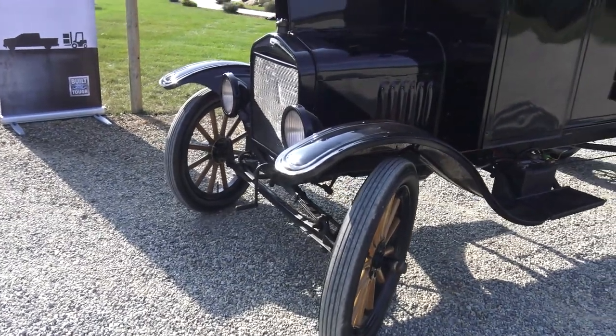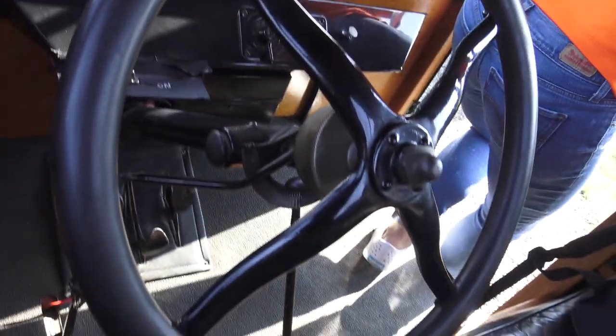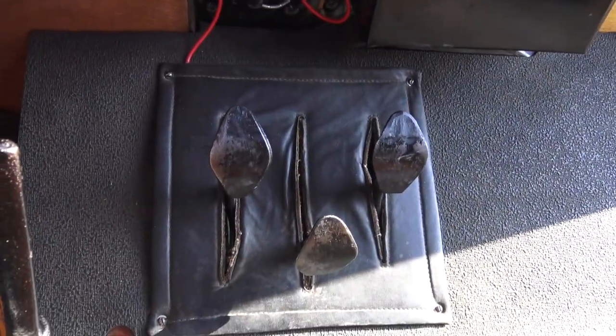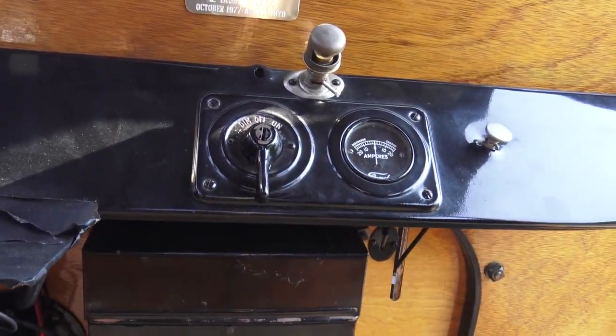The leaf springs — the Corvette had that back in the 70s. The old joke about a Model T: what do you call shock absorbers? Passengers. There are no shock absorbers. When the Model TT truck was introduced, we've got an on-off switch there temporarily. The pedal on the left is your clutch — all the way down is low gear, all the way up is high gear. The middle pedal is reverse. The one on the right is the brake, which is two cotton bands on your transmission. The big lever over here is your emergency brake. The TT truck's manufacturer spec was 18 miles an hour. But you see that lever there — that's an aftermarket Warford transmission. By 1924, there were 5,000 companies that made accessories for Ford Model Ts. That auxiliary transmission gets you up to 25 miles an hour instead of 18.